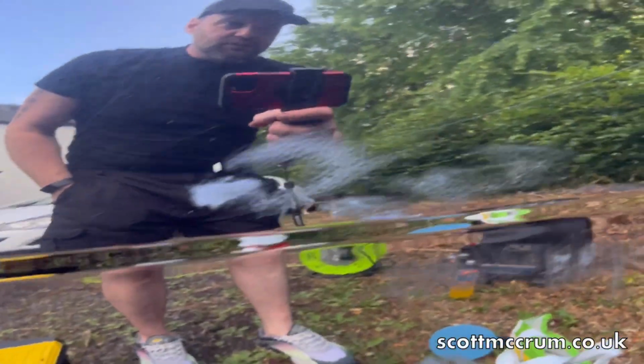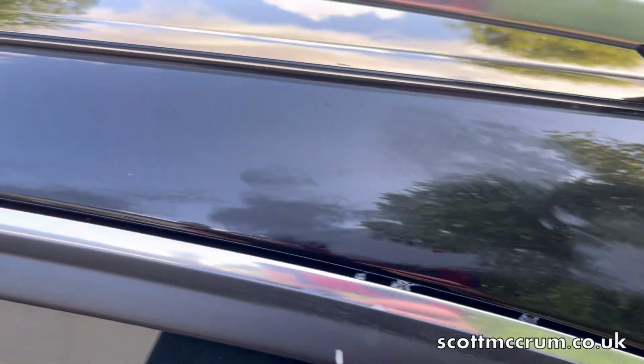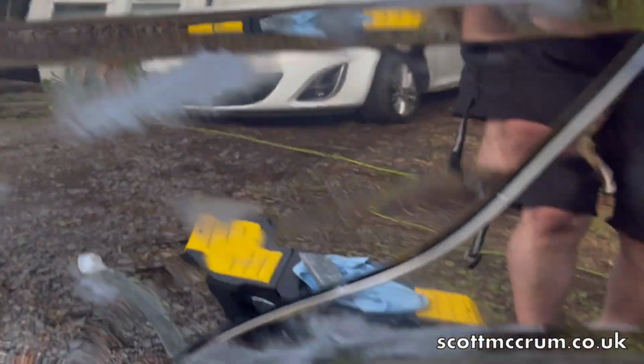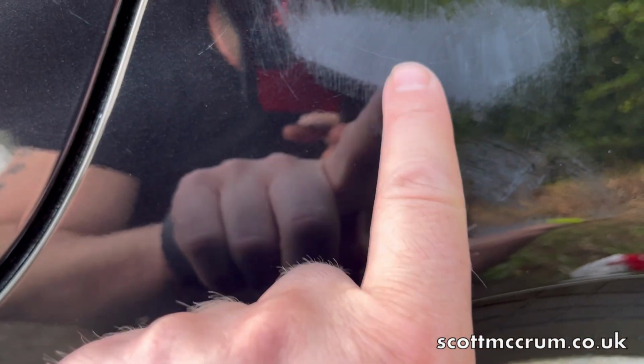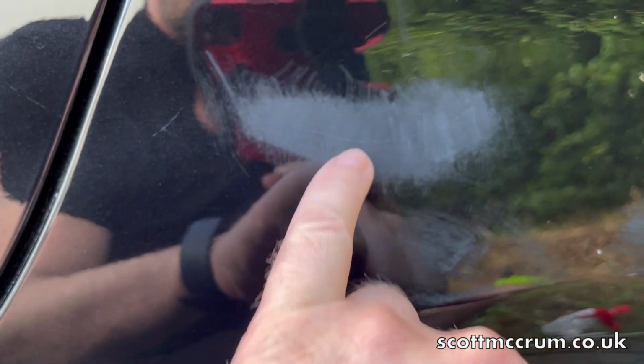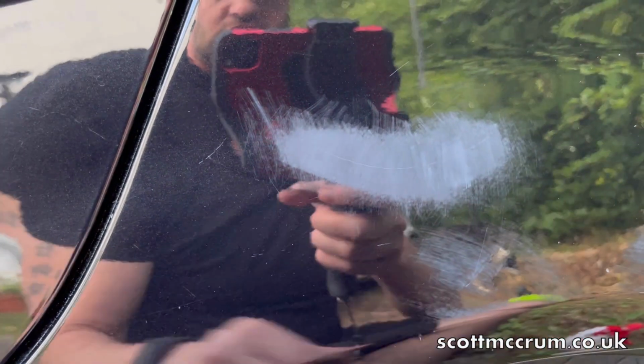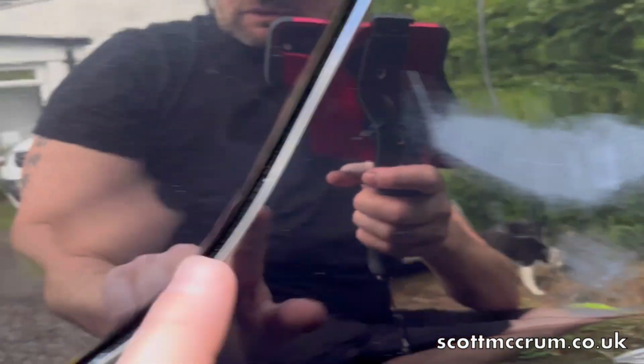That's all wet sanded. I'm not sure all the bits are all the same. So again, looking at where I started, just the same as the other side. Not trying to get rid of that completely because it's too deep and would probably burn through. But that's really smooth, you can't feel that at all. Which means that by the time we go over it with 1500, just gently, 2000, 3000 and then cut it, you won't be able to see that at all. Alright, so we'll get cracked on with this.